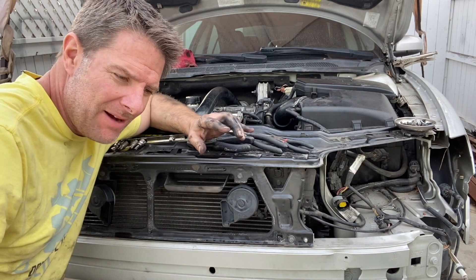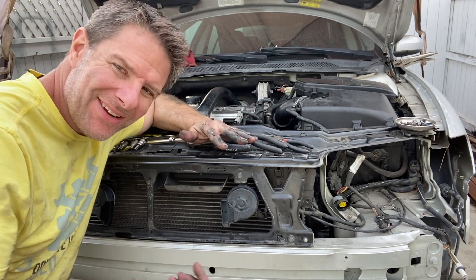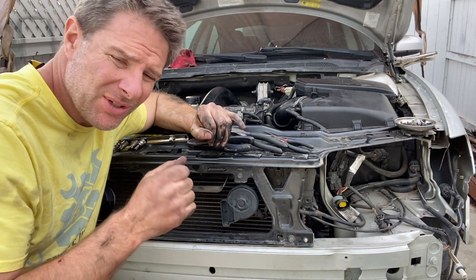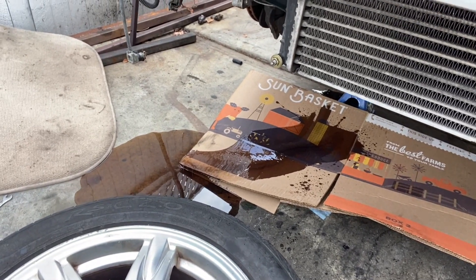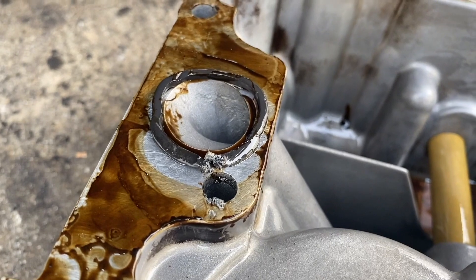I have a huge issue with the oil pan on this end of the car — I may have left an O-ring out. Didn't clean it enough and the anaerobic sealant hasn't sealed, and the bolts weren't that tight on that end. Something's wrong and it's pissing out. I still want to start it — I nipped the bolts up to double check. Yeah, I did something wrong. Damn it. Off she comes again. We must pay more attention to O-rings.